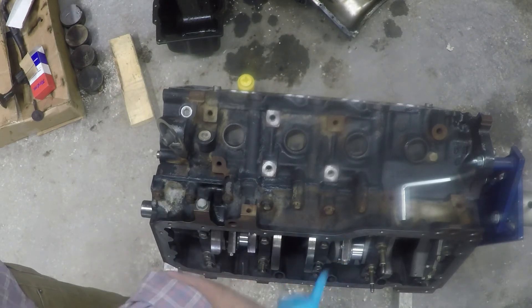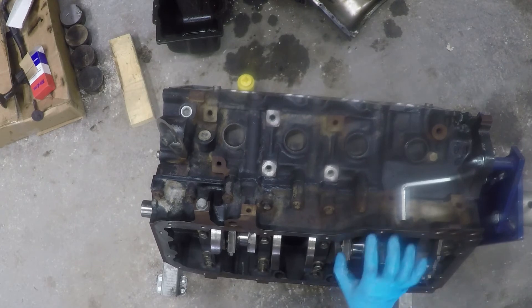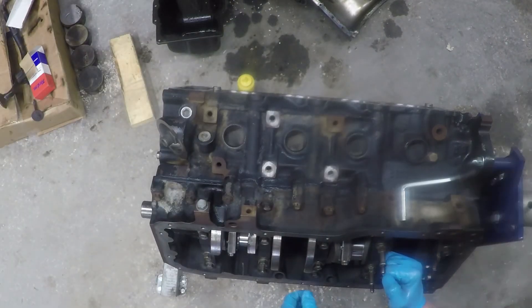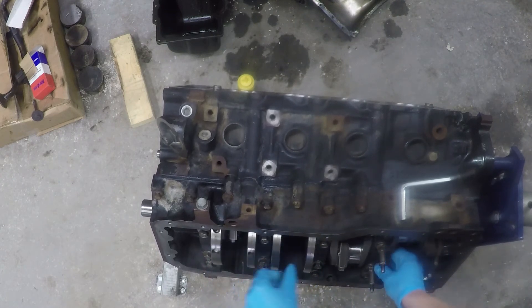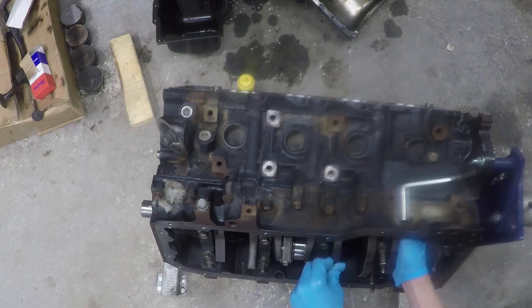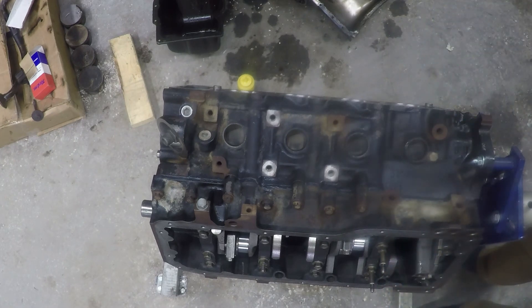It should be good because this is the same rod that was in there before, so I'm not quite as worried about that, but I'm going to check it anyway. 0.13 looks like that was my next one down and that did fit, so that's kind of my max there — good to check that before you move on. And then I'm going to turn the crankshaft to make sure it's not causing it to bind up or anything — and that feels like it's moving pretty smoothly. I do like to turn the crankshaft after every piston is installed, because that allows me to make sure if one is catching or binding, I'm going to know which one it is. So I'm just going to continue to do this — I'll probably set up a time-lapse and finish out the rest of these pistons. See you then.